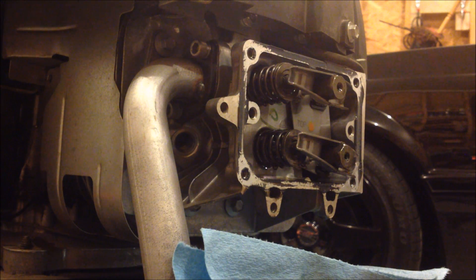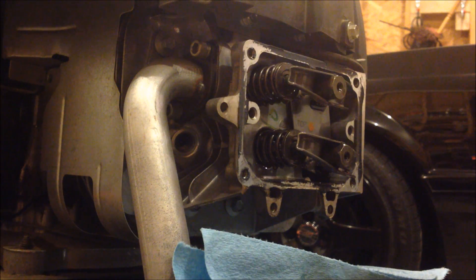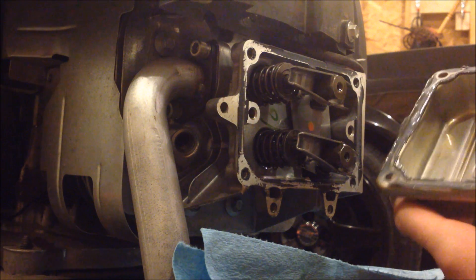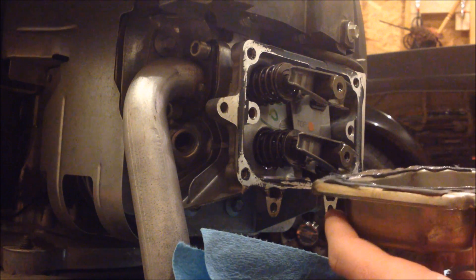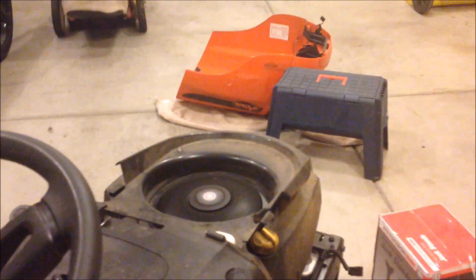Retighten this down — it doesn't have to be overwhelmingly tight. Now we're ready to put the valve cover back on and try to start the engine. Until you know you did it correctly, I wouldn't silicone it yet — just put it on as is in case you need to re-adjust the valve lash. If it starts up and runs good, then make your gasket. This is the moment of truth — first key on after the valve adjustment. Boom, first try! The fix is really easy — just take your time measuring and you'll get it.